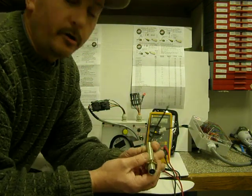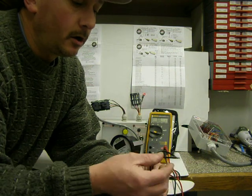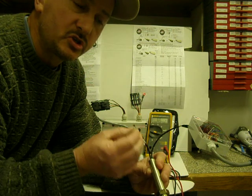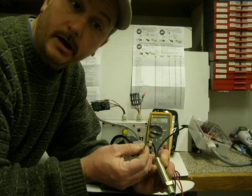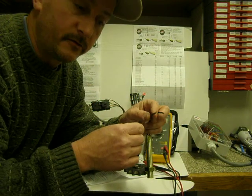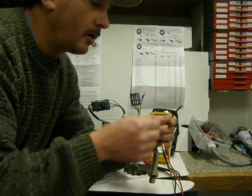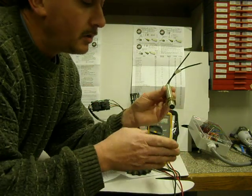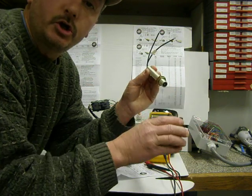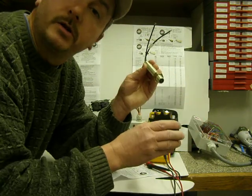How these are wired in: one wire goes to the chassis — you run a wire, butt splice it or solder it, put a ring terminal on it, and connect it to a good unpainted surface to ground or directly to the negative side of the battery. The other wire goes to your tachometer, which is the white wire. Put this into the proper specified setting, lock down the lock nut, and you're good to go. Set the tachometer for how many teeth are on the gear and you'll get the right reading.